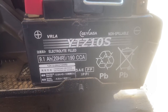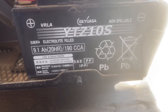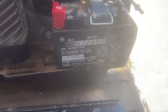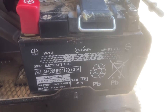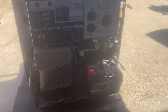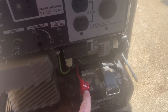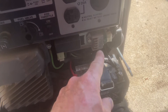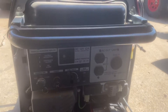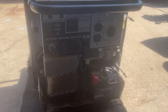If you have one of these Honda generators and need a new battery, the size is YTZ10s — readily available on Amazon. You can buy a cheap one for 30 bucks or a fancy one for however much you want to spend. I highly suggest you hook up a charging lead and run it out the side somewhere — maybe drill a hole through the cover — so you'll be able to keep it charged up when you don't use it.